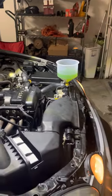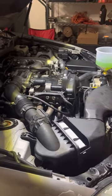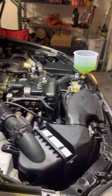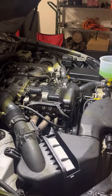First time start up — didn't get a chance to properly bleed the cooling system. So that's what we're doing right now. I believe that everything has opened up, got heat out the vents, shook both upper and lower radiator hose. Running good, running smooth.